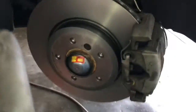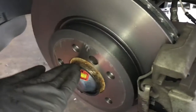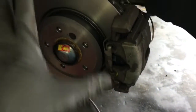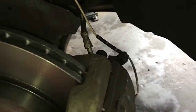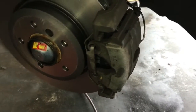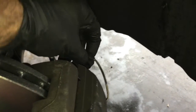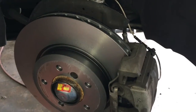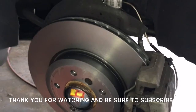Now put your wheel back on and torque it down, then duplicate the same thing on the opposite side — except the opposite side is not going to have the sensor. On this particular vehicle, the left front will have the sensor, and the right rear will have the sensor if you're doing the rears. Lower the vehicle down and pump your brake pedal six or seven times to push the fluid back from the master cylinder back into the calipers. You should have a nice firm pedal before you drive the car. If you pump it six or seven times and don't have a firm pedal, you need to bleed the brake system. That completes the front brake pads, rotors, and sensor replacement on a 2008 BMW Z4. I'm Brian Essex from How To Automotive — thank you for watching and please subscribe for more valuable videos.